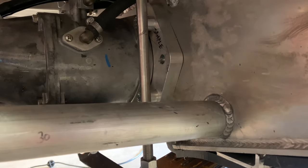All right, so now that my pilot hole has been drilled, I can go to the other side where I actually have some space to work and get the rest of this drilled through to 680 thousandths, which is the OD of this hole here.